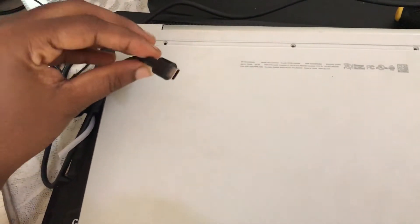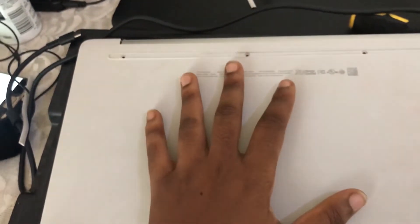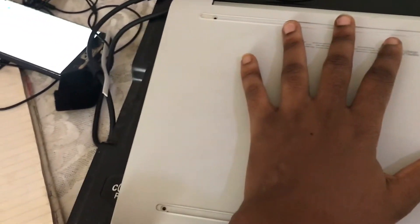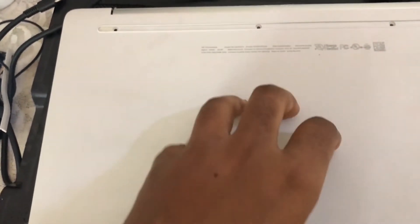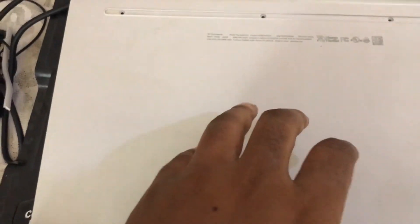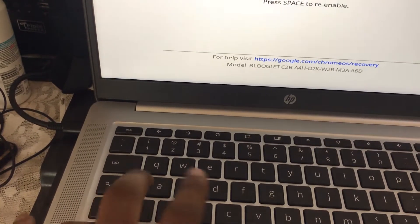Because we have disconnected the battery, we have to use our AC adapter to power on the Chromebook and then use the codes that will be used to disable the write protect. On this kind of Chromebook — the one I'm using in this tutorial — there is no write protect screw. I'll put the adapter into the Chromebook. OS verification is off — press Ctrl+D to skip this.